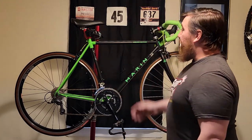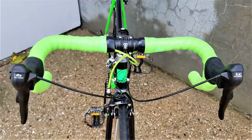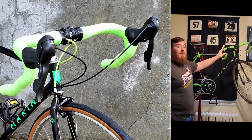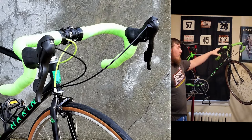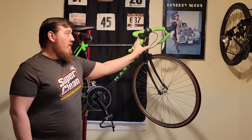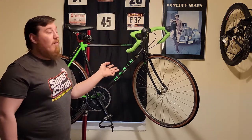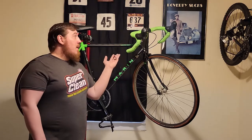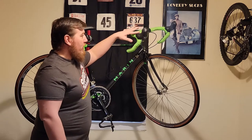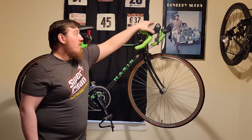The rest of the drivetrain has also changed. Getting into the cockpit — not only are we getting comfort, but you get all the luxuries of modern setups. We have a MicroShift 9x3 set of STI shifters with your shifters up and down and nice tight brakes. They feel great — I've had MicroShift before and I've always been very happy with it. It's compatible with Shimano and Sram, easy to set up, and it has a really long hood so if somebody has big hands, you get a lot of comfort there.